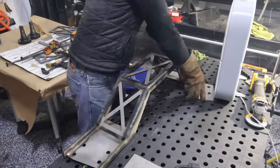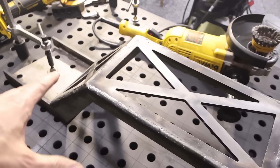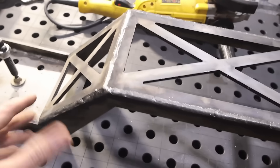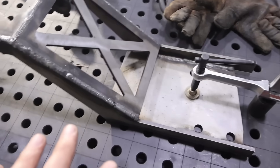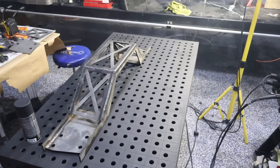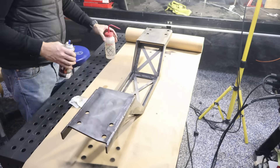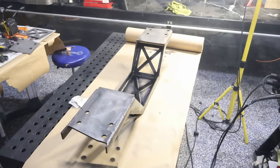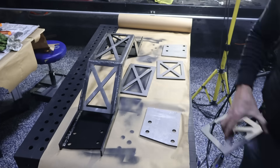We have about half of this welded up — all those panels are fully welded, but that's only half. I've got panels on the other side still to do. What I'm going to try is actually doing a coat of paint now on the underside, because it's hard to spray through to the underside later. So I'll paint while I can on these, then weld the other sides.